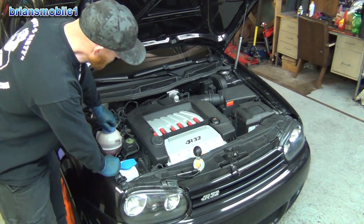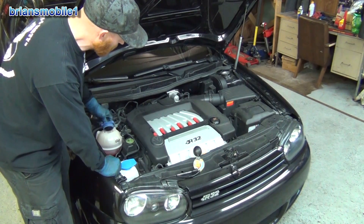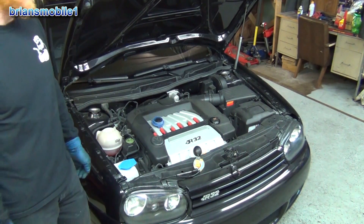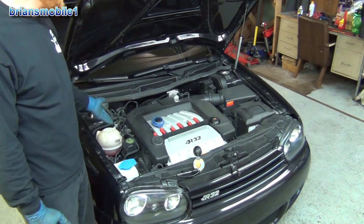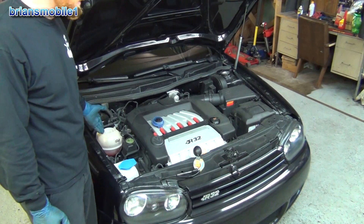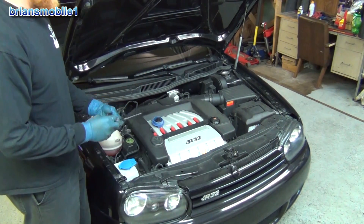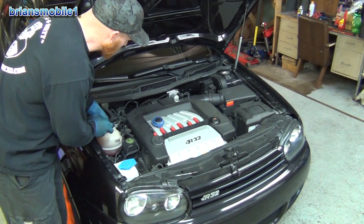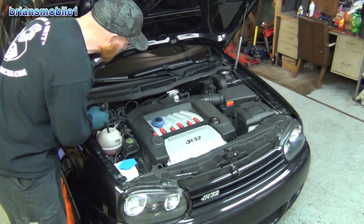When you winterize your car, going into winter if you're having hypothermia symptoms, if you're cold, if you're shivering because your heater won't work, it may be because it's out of antifreeze or there's air in the system making your heater not work. You want to check and make sure that the specific gravity of your antifreeze is such that you have adequate protection.